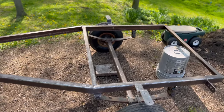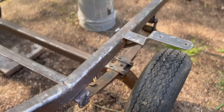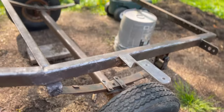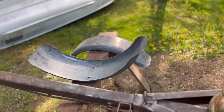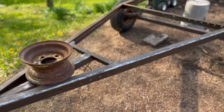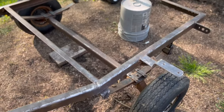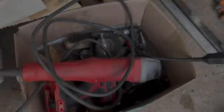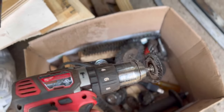Here it is all ground down as far as I'm willing to go - looks pretty good. There's still a little rust, so a little touch-up to do before we paint it. My dad's gonna take off the wheels and do those. We have a spare tire rim right here to clean up and paint. The fenders are all cleaned up down to bare metal and we're gonna paint this tomorrow hopefully. This is what I used to wire wheel the whole thing - just a grinder with wire wheel heads and a drill with wire wheels as well.